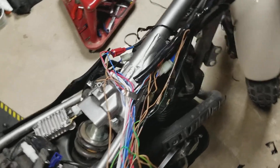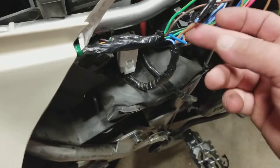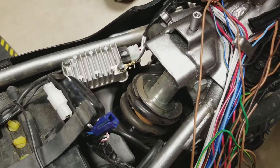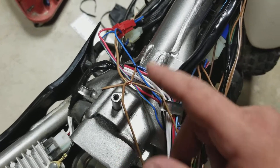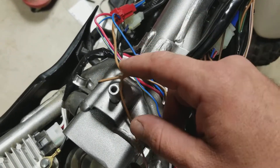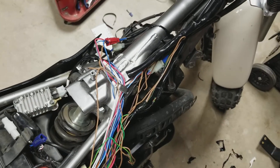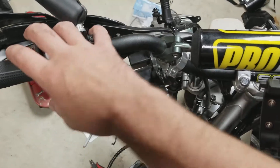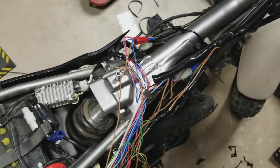To get into that, what I'm going to do is cut this further here because this is just getting ugly, and I'm going to run this wire up to this wire and splice them together and splice that into my main switch power coming off my key. I'll also run a wire off through a small two-amp fuse to my GPS unit. Then off of that, I'm going to run into a smaller switch that I can mount up on the dash or up onto the instruments here, and then run a relay to switch this power on and off.